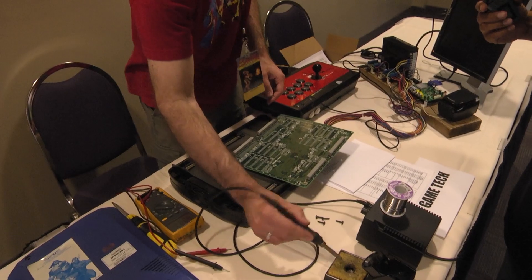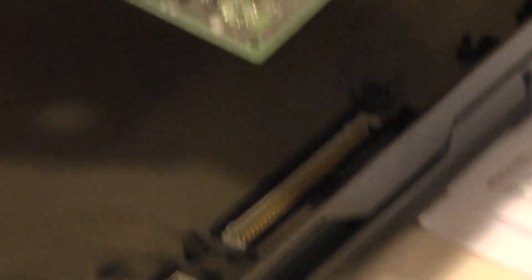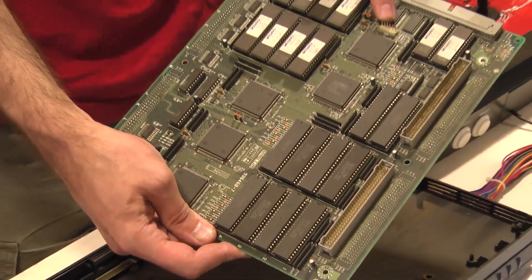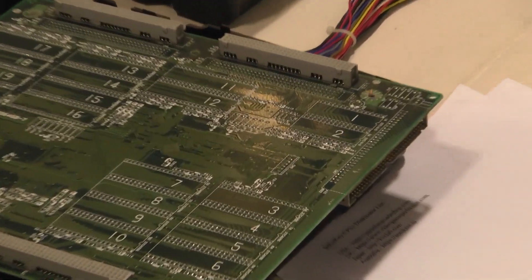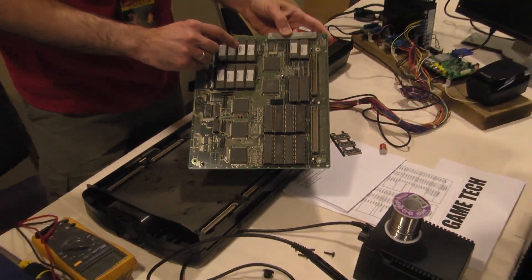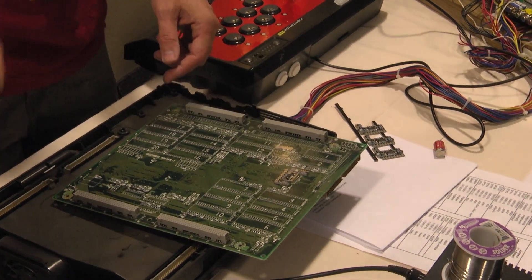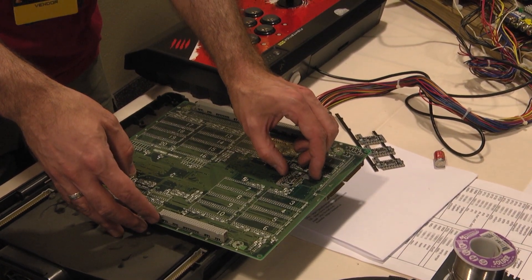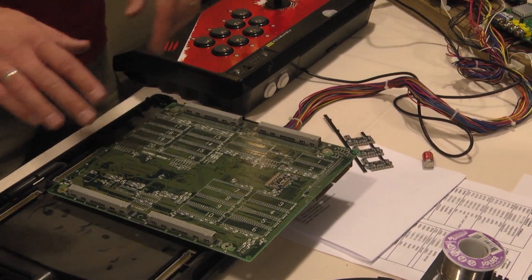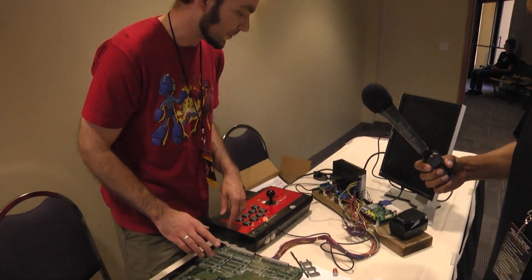So I'm going to pull this guy out. On this revision — it's a revision seven — five, six, and seven have this header here, so we're going to install the Infinity Key on the back side. Actually, before I put that on, I want to check the labels. So this is MVSU — Marvel versus Street Fighter, U for USA. It's good to verify that and not just rely on the case color, because sometimes cases had goofy colors. Particularly in South America and Mexico it's kind of wild west — all kinds of different region ROMs and different colored stuff. So always verify the actual labels.